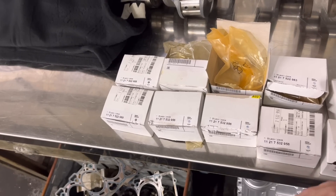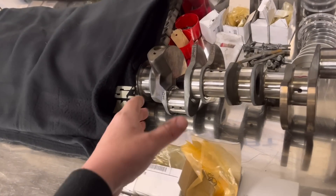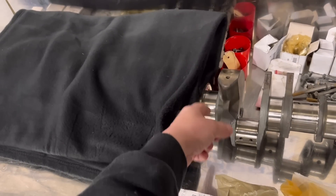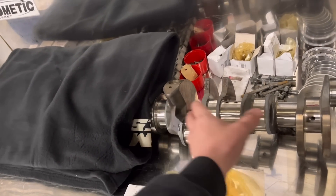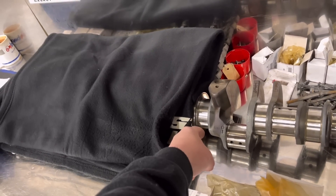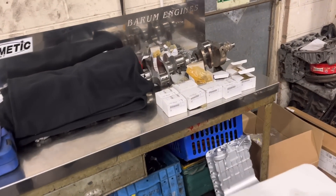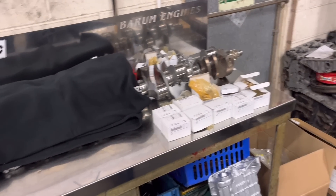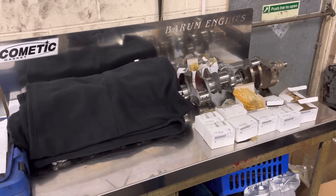Their mistake obviously. You've got four mains - all the same - with tops and plain bottoms, and different top and bottom thrusts. But they've sent standard size instead of 0.5 undersized on all of them, and on the thrust they sent two upper bearings instead of an upper and a lower. So that's going to be another week or two before we can get on with this job. Paul has put a con rod on the journal and plastic gauged it, and we're looking at about two thou running clearance, which is absolutely perfect. Yet another setback.